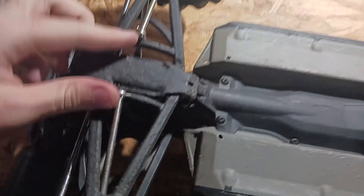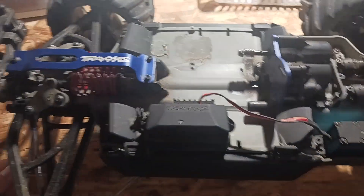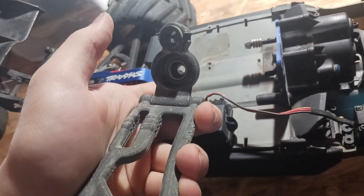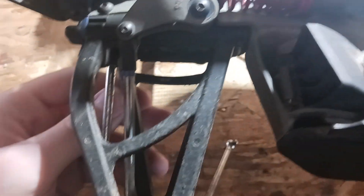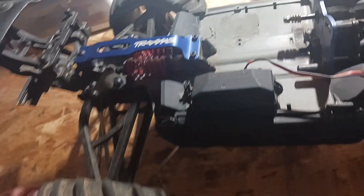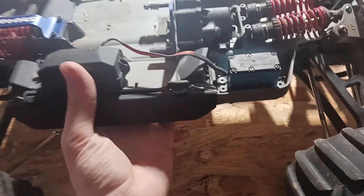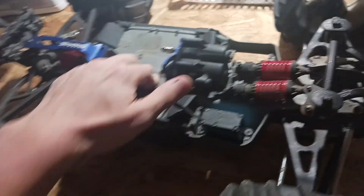Here's the underside — not too bad. The drive shafts are flopping around. I put a True Track rear arm kit on this thing, which gets rid of the toe links, but with that on there the drive shaft cups kept coming out of the diff. I didn't like that so I put the stock setup back on. I don't run this thing hard enough to destroy it — I don't jump this truck, I just drive it nice and pretty.